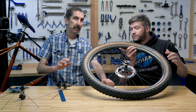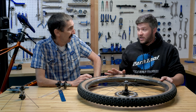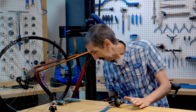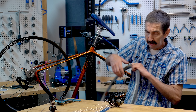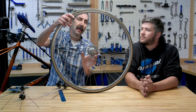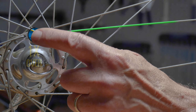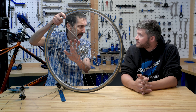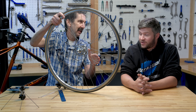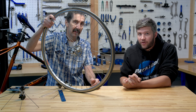You can see there's a little gap between the last crossing, so it is a very straight spoke all the way to the rim. Some years ago people would have said that's going to collapse - you cannot possibly ride that. But apparently it does fine. Now let's go way back and look at a four-cross pattern. These are almost always interlaced. Here's an older classic Schwinn Paramount hub - a one, two, three, four cross interlaced.